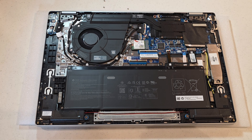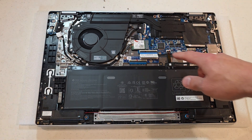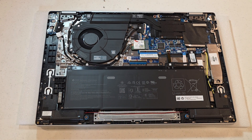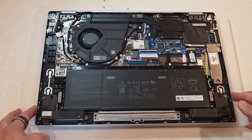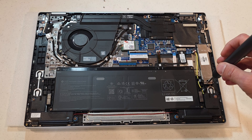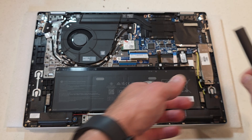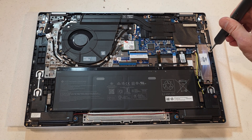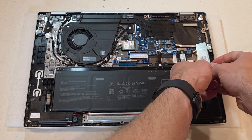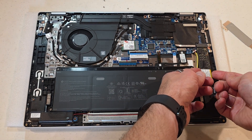Once you get the top part separated, you can carefully pop this off and it just disengages all the clips, and then you get access to the internals. You've got a few things that are replaceable or maintainable. First, obviously, you've got your fan and heat sink, relatively easy to get to. You've got your WLAN adapter, the battery of course, and it's nice that there aren't any plastic trenches for cables around the exterior like there are in some laptops. And then of course you've got your SSD, which is maybe the most important thing of all. Let's see what we get here underneath this heat shield.